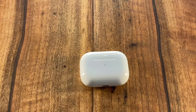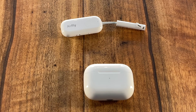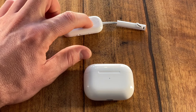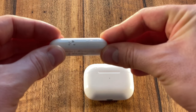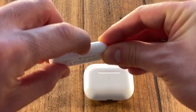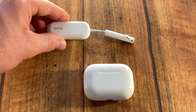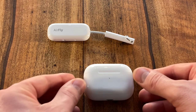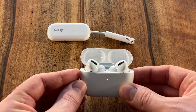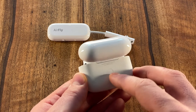You can now close the lid. Now, it's best to turn off Bluetooth on any Apple devices close by. For the best results, reset the AirFly Pro. To reset, press the big button for 4 seconds to turn it on. After that, hold the small button on the side for 4 seconds. Your AirFly Pro will confirm the reset by flashing amber a few times and then switch to rapid white and amber flashes. Now that your AirPods and AirFly Pro have been reset, you can retry the steps from the manual and this time the pairing should succeed.